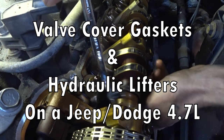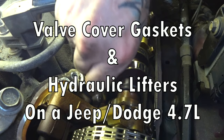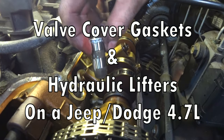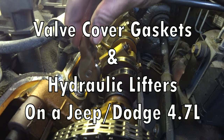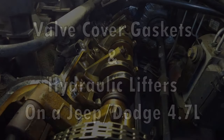Get your hand down there to catch it. Here is your rocker and here is our lifter. You see that play? That's no good. All right, so we're going to take our new well-lubricated lifter and just slide it right down in there, right like that. Then we're going to take our rocker, just like that.